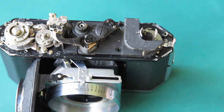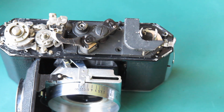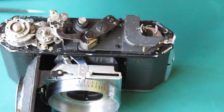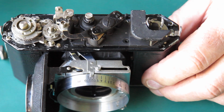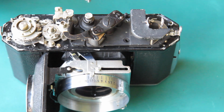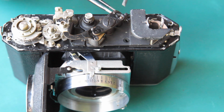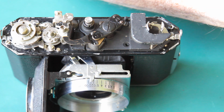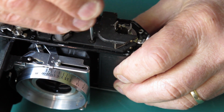That shaft probably needs to pull up from there, but I bet it's reluctant to do so. I'll put a screw in the top, see if we can pull it up. That's better. That's just lifted into position. The rangefinder body is held to the camera top with 3 large black screws. Now the rangefinder here is exactly the same as you'd find on a Retina II Type 142.